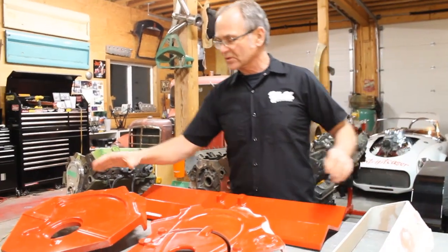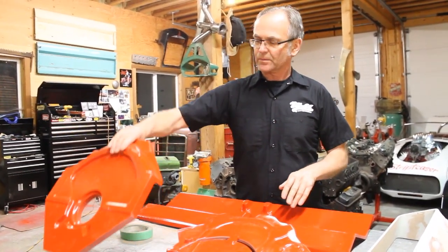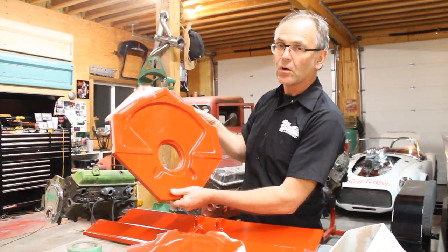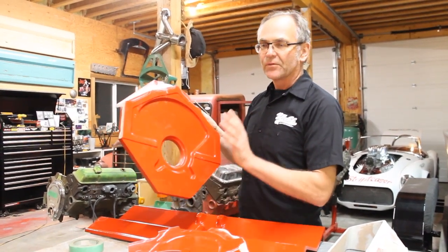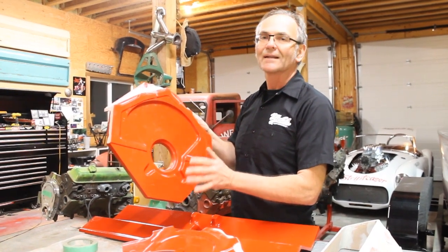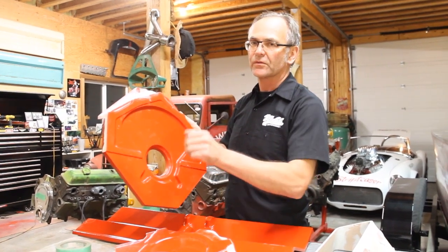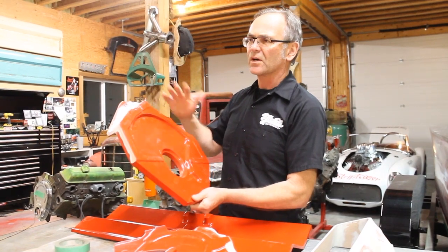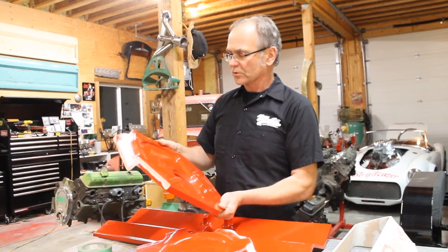This is the back part of the motor — where you bolt your transmission. A lot of you maybe don't know much about electric, but if you run a four-speed transmission behind an electric motor, you only need half the capacity of your motor because you've got the gears. I'm going lower voltage — 96 to 144 volts — a lot easier than Tesla's 400 or 800 volts.